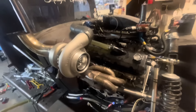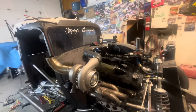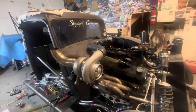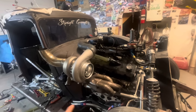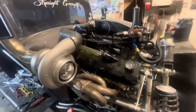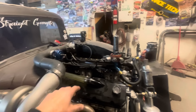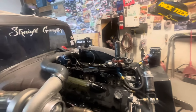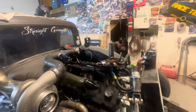These are the headers that were banged up in the accident. I built these for the Dirty 30. Why are the turbos back there? Well, the turbos are back here initially — I like the short pipes. The short pipes have an advantage. Placement to get the valve covers on and off is a little bit easier. The intake is facing backwards because the turbos are in the back, and I don't want to have tubes running back here like I did on the Dirty 30. The Dirty 30 had a taller firewall, so I couldn't have a throttle body on the front side — I had to run it back and bring it back around, which made it a little more difficult.